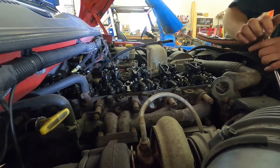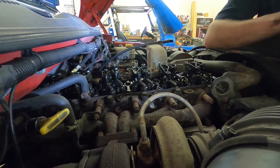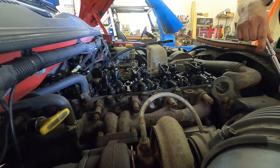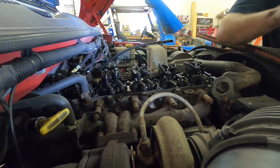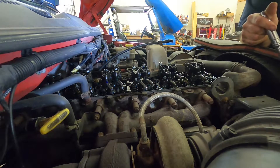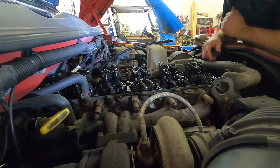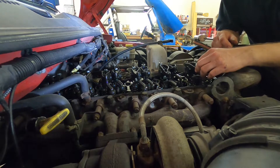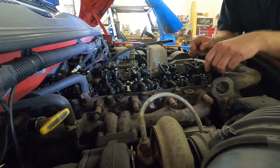Using the companion cylinder method, I'll watch cylinder number 6 for where the intake and exhaust just start to cross over. The intake just closed and the exhaust is starting to open. We're actually rolling this motor backwards. But because 6 is up, that means that 1 is in its set point.